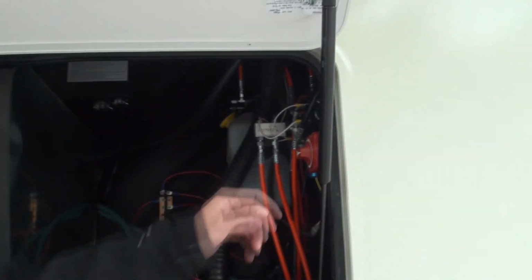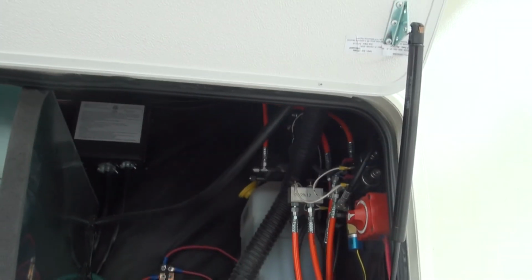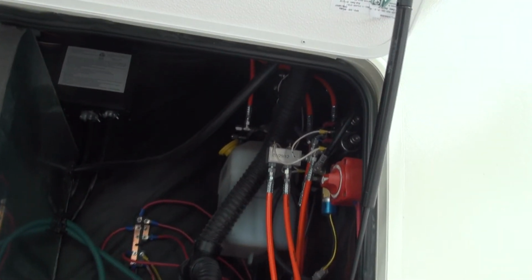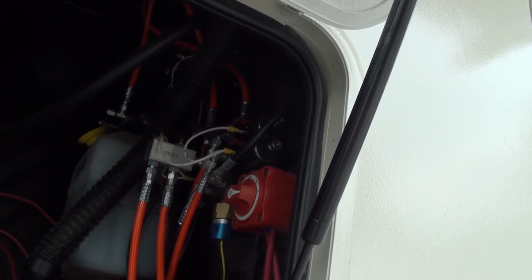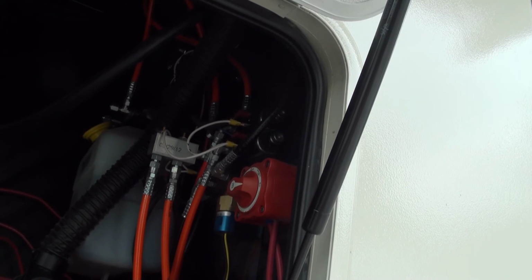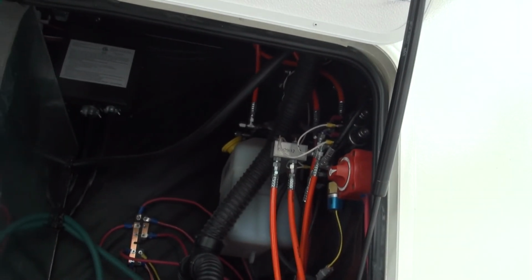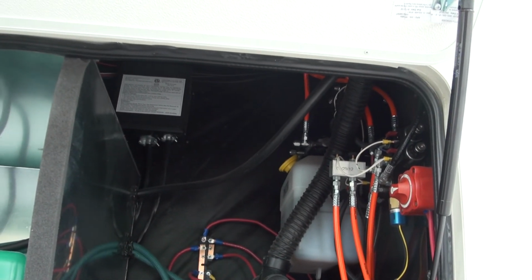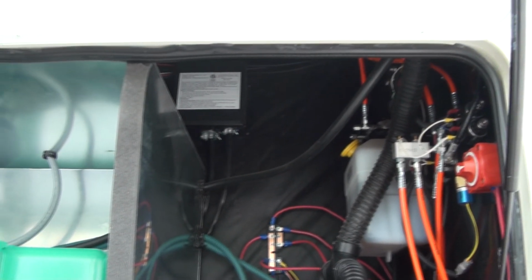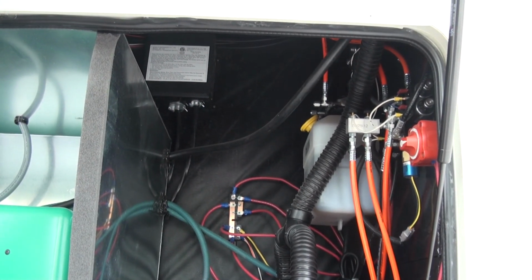Your battery disconnect. You familiar with that? But go through it. It's basically a 12 volt master shutoff. That's what it is. Shuts everything off. If you were not plugged into shore power and not running your generator, and I flip that off, we lose everything that's 12. Okay. Now, on the Redwoods, some trailers, when you have that in the off position, will still allow a trickle charge to the batteries. So that's important for you to know. And I'll double check on the Redwoods again. It shouldn't. You'd think that they would have thought about that. So when you flip that off, really nothing is going on with the batteries.